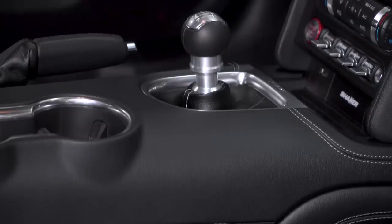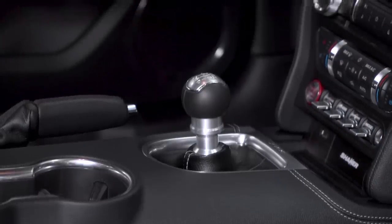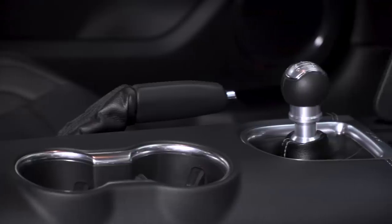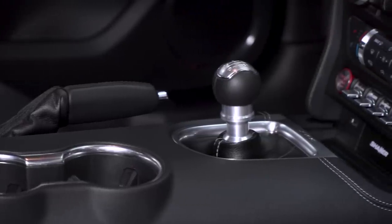The work of the install is totally worth the upgrade in my opinion. This shifter gives you mounting options: you can mount to the transmission or to the body of the car. If you mount to the trans, you'll run the solid linkage and eliminate the tie to the body of the car. If you mount to the body, you'll use a different bracket and the upgraded linkage will help the shifter remain remote but still keep accurate shifts. The linkage has a three-bushing design, and of course this shifter works with the stock shift knob.